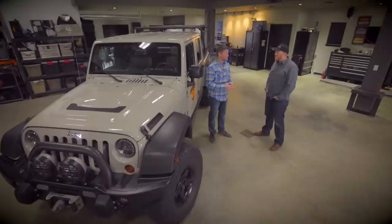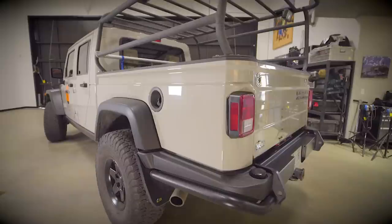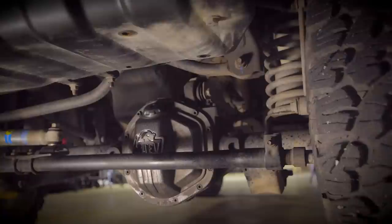All of our parts go through a full thermal chamber. We'll actually roll a whole vehicle in and test it from minus 50 to 145 degrees. We check for dissimilar parts and how they expand — like plastic versus steel — and make sure there's enough clearance for the parts to expand at different rates. There's a lot of testing that goes into these parts that people never see, just long-term durability stuff. The devil's in the details, but it's the long-term usability of that product that will make you love it or hate it. I'd love it for you to show us some of those aspects of what that looks like to make it look OE — original equipment — but yet with your own flair.